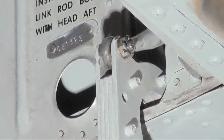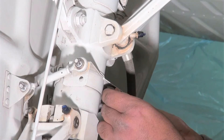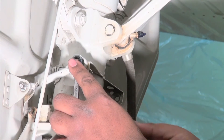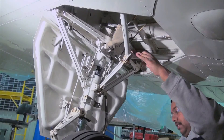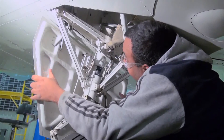The outboard doors have easier access and the work will go more quickly. The outer gear door turnbuckle stays are removed from the gear legs. Note the position of the washers. This is much easier and it's a one-man job.